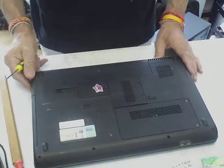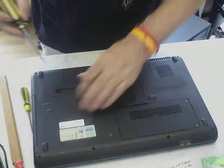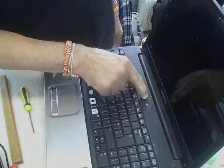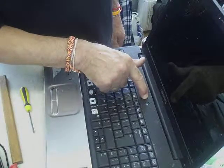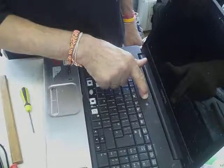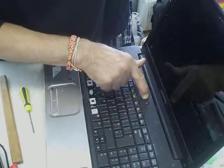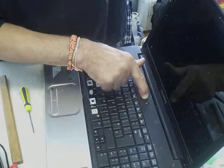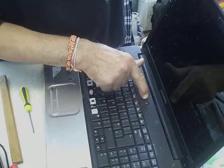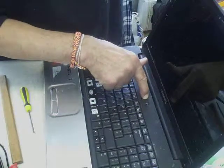First things first, for the laptop — let's get the battery out so there's no power going in. Unfortunately this still leaves a lot of current in the motherboard, so what we do now is hold the power button in for 30 seconds to a minute. What you've got on a motherboard are capacitors — they store charge and retain charge. If you look at a time-capacitance chart, you'll see the trail-off goes to infinity, which tells any physicist or electronics engineer that the capacitor never truly fully discharges.